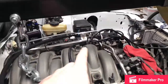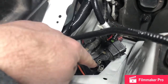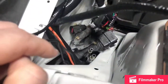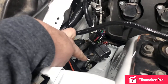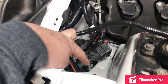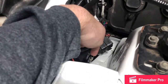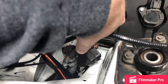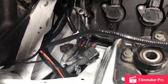So the fuel rail on the Coyote is 3/8. This car is supposed to have a 3/8 line, and it's a 98, right? From what I understand, they're a little bit of an oddball year for fuel. This has a quarter return and a 5/16 feed like a Fox. I don't know what a 96 or 97 has, but the interwebs told me that this was 3/8, and she ain't, boys. It's like a hot dog in a hallway right there. So that ain't gonna fly.